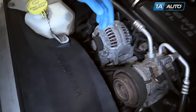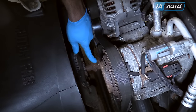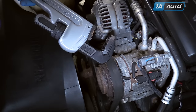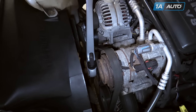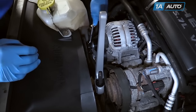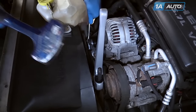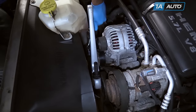Your radiator fan is located at the back of your radiator attached to your water pump. There are a few different ways to take this off, but we're going to use a pipe wrench secured to the nut, a 3/8 ratchet to add a little bit of tension to our serpentine belt and keep the water pump from spinning, and a hammer. We're just going to knock the nut loose.